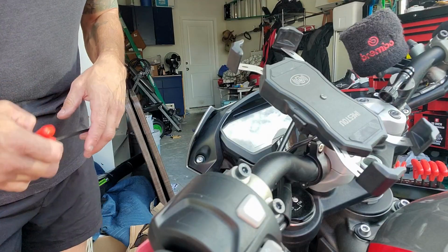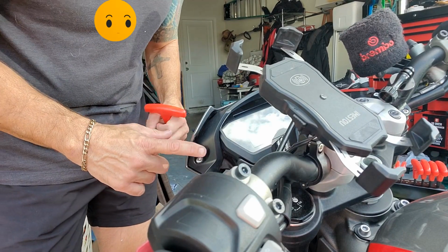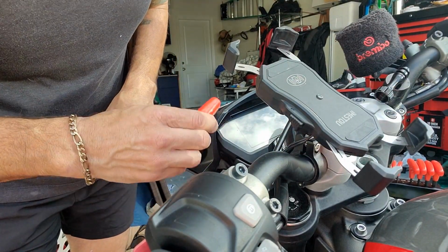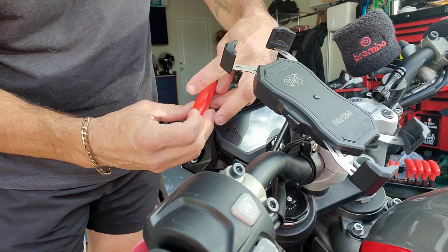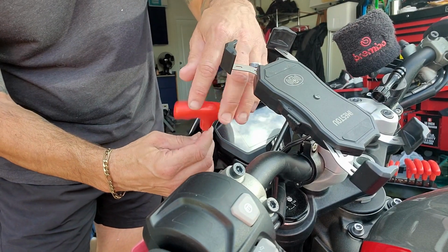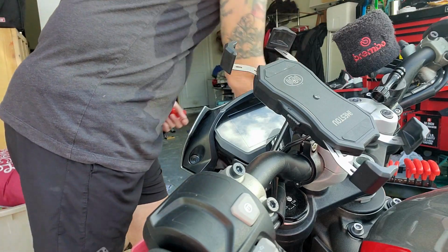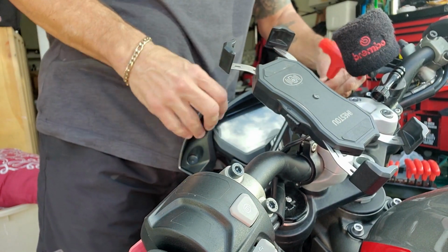Let's check it out. Okay, so first thing you've got to do is, right up inside the Flyscreen, there's a bolt here and a bolt over on the other side. I've got this phone mount kind of in the way, but let's get a number 5 Allen. I'm using a T handle because it's just easy. We're going to pull this out. We don't want to lose the bolts, so we're going to put these bolts somewhere safe, in this chair right there, and then we're going to do the other side, and you can already see it's loosening up in here.